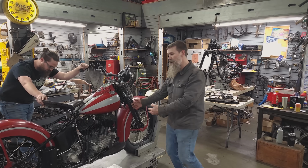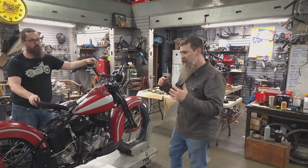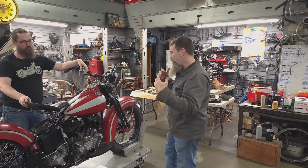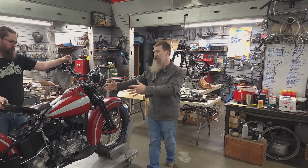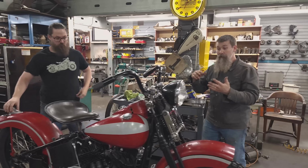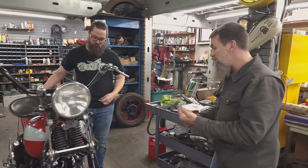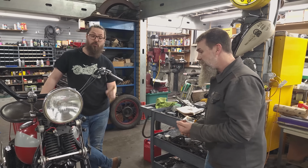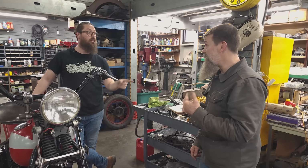He's got the long front end. Like he said, the 19-inch wheels. This thing's absolutely going to be a mountain climbing machine. Flanders bars. So all the coolest stuff you can put on a bike we got loaded onto Steve's machine. Bumped it from 74 cubic inches to 80 inches. The motor's a what, a 19? It's a 1944 U, but it's bored out to be a UL. So you bored out to be a ULH, so the H is the 80.